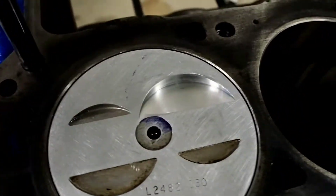Remember how I said I had valve relief? Well, I did have valve relief, but the problem is I didn't have radial valve relief. So I'm learning this part of engine building — I've never had one apart, never built one from parts like this. Nothing just kind of slams together unless you're doing stock rebuild stuff. You've got to check all these measurements and recheck them. Even when you think something's right, it may not be right, which was my case. I had depth clearance — the valve could go down far enough — but every time I would test it out, doing what's called a drop valve check, using a checker spring.